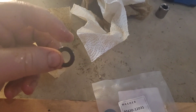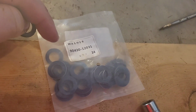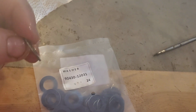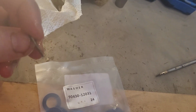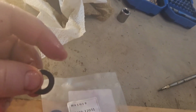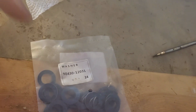One mistake a lot of people make is not replacing the oil plug gasket. You can see the old one here, and I buy these by the pack, and they're very cheap and can save you a little bit of aggravation later down the road. These things are designed to crush, and once they are crushed, as far as the purpose of the sealing, it is a very good idea to replace them with a new one the next time you change your oil. Again, link down in the description.